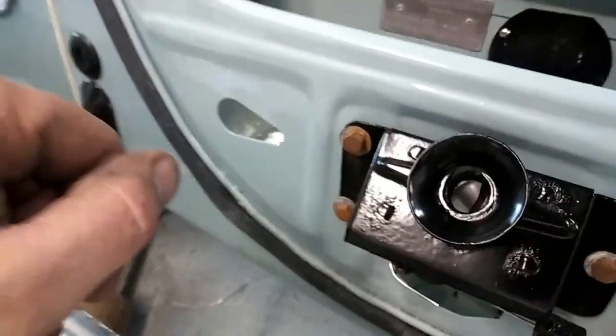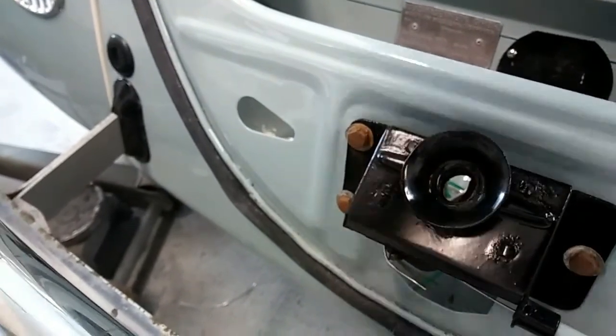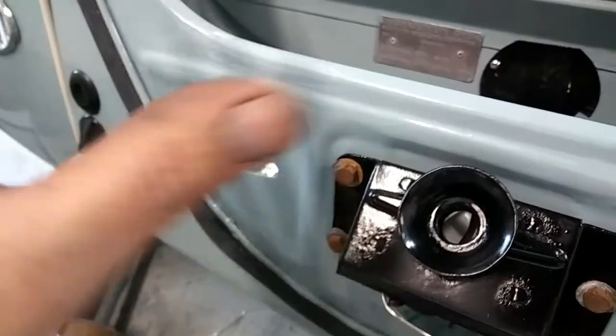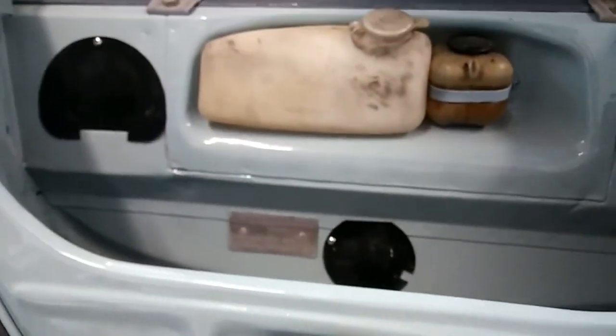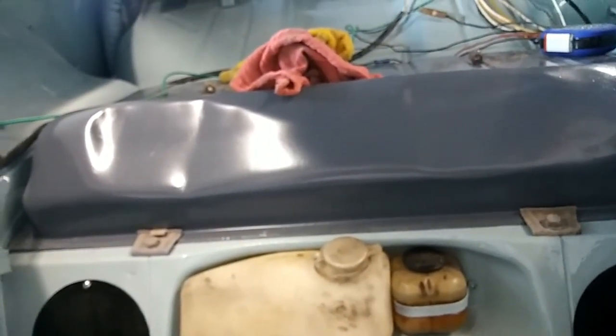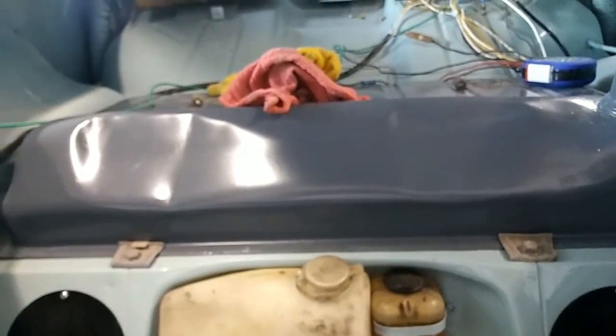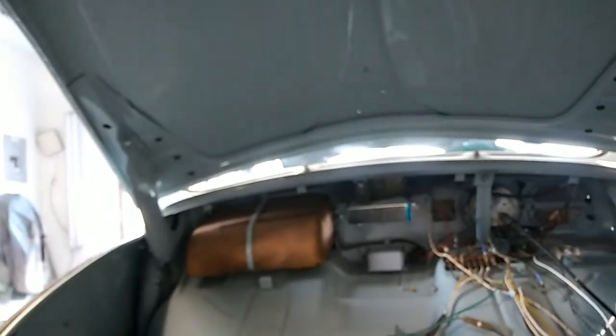You play around with it a little bit. Make sure you have a friend around because you're probably going to have your hood not open by pulling the handle once or twice before you get it in the right place as far as spring tension goes. So usually what I do is I over-tension the spring a bit first, and then I start backing it out until I know the feel of it. A lot of this stuff you want to do before you do your body work.